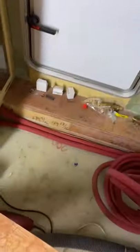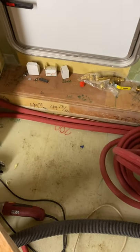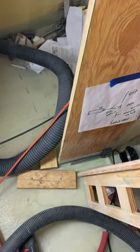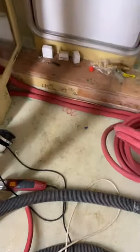Up above that is a burp tank right here. It's going to be a shower outlet. Anyway, I made a piece for the front of the step here. That step is only seven inches wide, and after all the hoses are on — which includes water hoses, they're not here yet — we'll glue this in place and make the step the proper width. If we have to service those lines, we'll have access to get them in and out through those voids there. There's no reason to install that now while we're doing all the plumbing and make the plumbing harder.